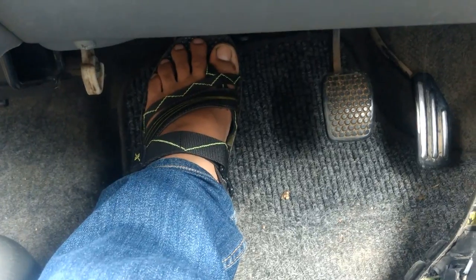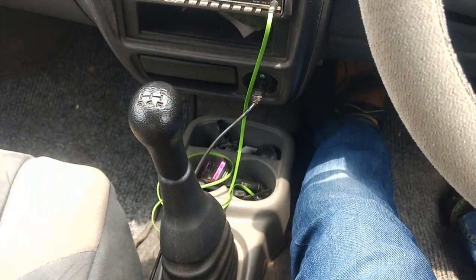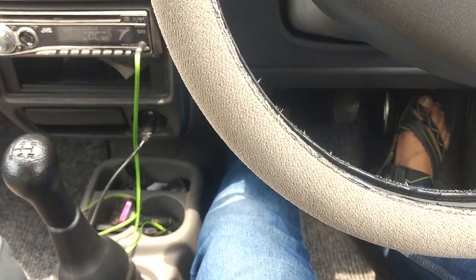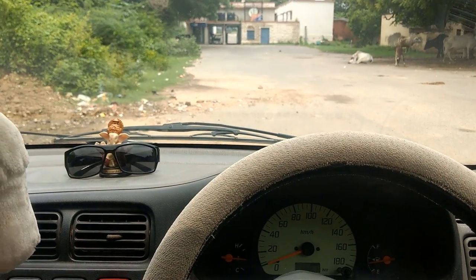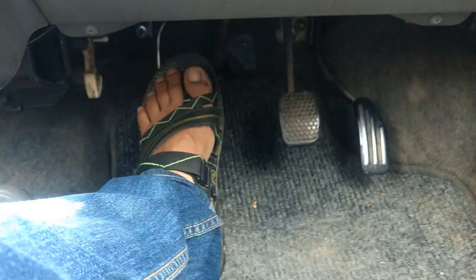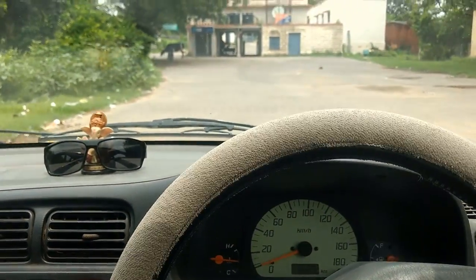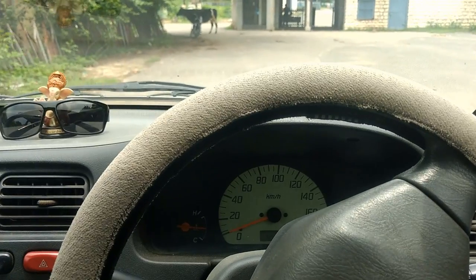I have pressed the clutch because my car was in gear. Now, what do you have to do? Put the car into first gear. I recommend learning on a flat surface, which makes it much easier. Now you have to slowly release the clutch — you can see the car begins to move even without giving accelerator. The clutch will release smoothly and you will be able to move your car.